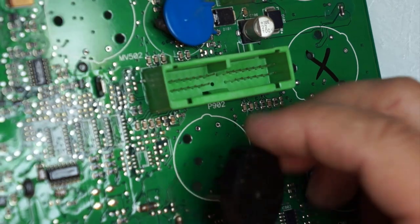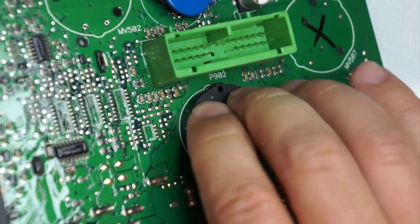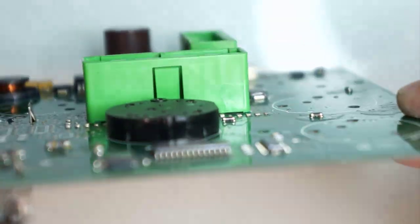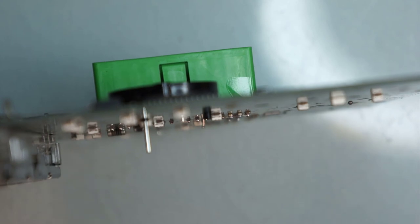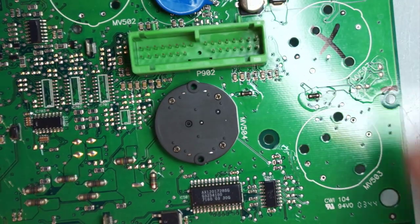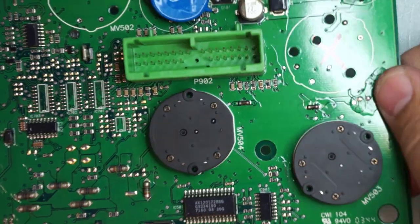So make sure where the speaker side is, that is where you're going to be installing your motors. That's the side. So you'll just find a hole, set it just like the circle, slowly. So I got the pins through, stepper motor through. As you can see, it's flush, perfectly installed. And all those other four pins are sticking out really nicely. So we'll do this to every single one except the ones that we marked. So find the pin, make sure you slide the pins through well.